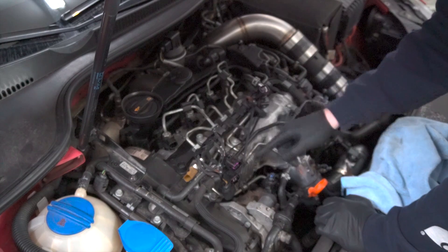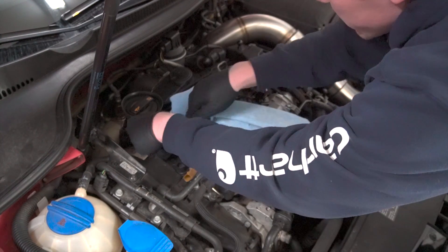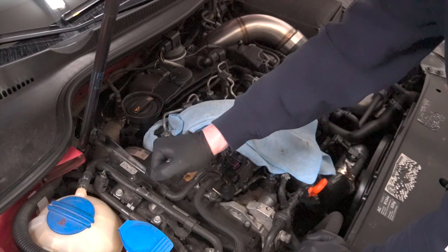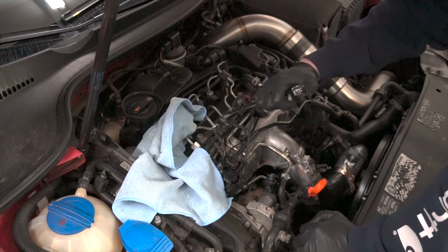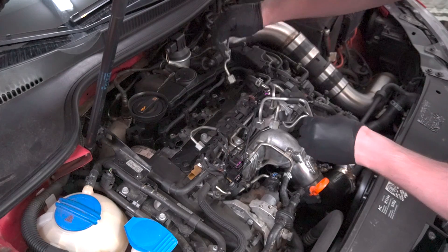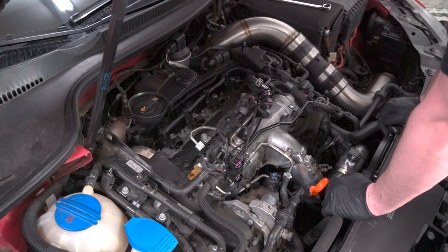The guide posted in the description wants you to pull all these secondary fuel lines that feed the CP3 or CP4 fuel pump out of the way, but we're not going to do that — it'll just take a lot more time. We're trying to do things as efficiently as possible, so we're just going to tuck a rag up in here and crack off the fuel lines. Everything is a 17mm on a Volkswagen, so I'll crack all these lines off and come back once ready to remove them all. Lines are loosened off — mind the orientation of where each line goes. Pull all these guys out and move them out of the way, and now we have the fuel rail off.